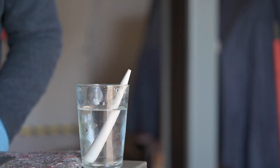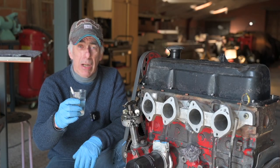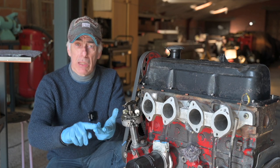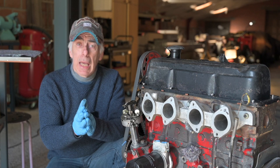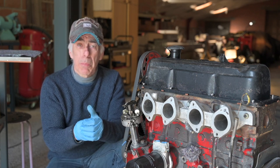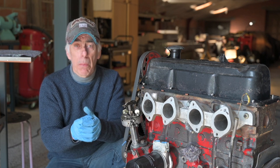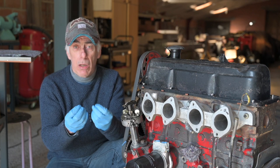And that's how it works — very simple. Of course this was a bit simplified, because the carburettor has more jets inside than just one. We need the right jet for the right regime of the engine: idle, acceleration, cruising, wide open throttle. On top of that, the proper mixture is going to be determined by the nozzle or jet opening, but also by the type of engine, the displacement. These are all parameters we need to consider when properly jetting the carburettor.